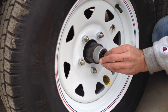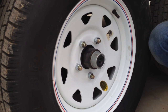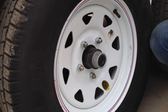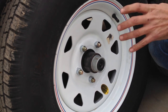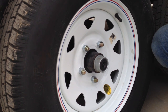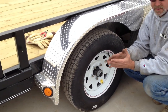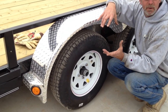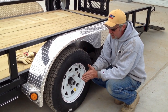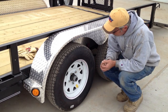So how do these brakes operate? The truck provides power — they're electric brakes. Your controller in the truck puts out voltage anywhere from two or three volts up to 12 volts. The way an electric brake works: there's a magnet in there, and as voltage is thrown to the magnets, that sucks the magnet against the face — like an old hydraulic car brake. When that magnet gets pulled against the face from the voltage, that applies the arms and makes the brakes engage. Pretty simple.